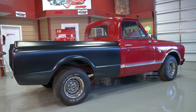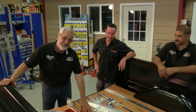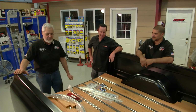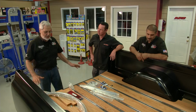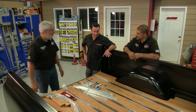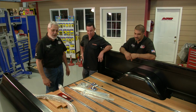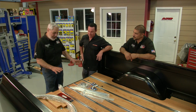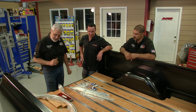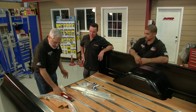Now, ahead of time, this beautiful wood kit, this is oak. I stained it, sanded it, put some varnish on it, urethane. It looks great. Take your time. Got nice stainless steel strips. That's right. Hey, some guys even take and spray an automotive clear coat on there and color sand it. They get crazy with that wood sometimes. Oh yeah, I like a semi-gloss, and that's what this is. You can make it as glossy as you want, but there's some tips and tricks, and you get all the instructions with it. So make sure you follow them.